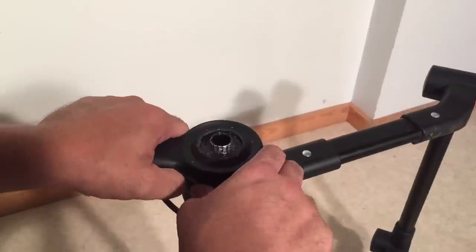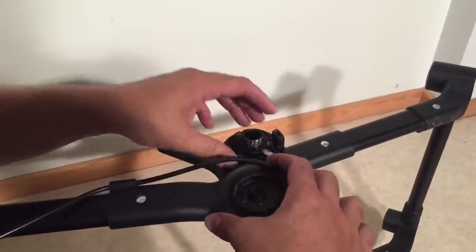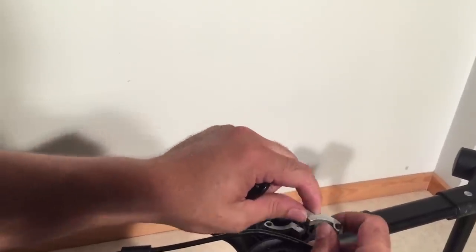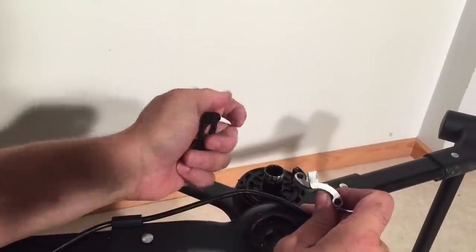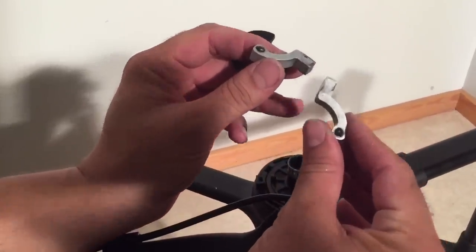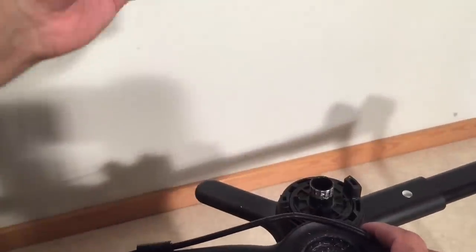Opening this up, you're just going to pop off the first part. What you will inevitably first encounter is the disc — this is the central locking disc. And these are these two — I call them S-hooks, I don't know what they're actually called — these two metal parts. The pegs from the disc have broken off into the hooks. This might have happened with one or two pegs. In any case, it almost inevitably happens with Chameleon 3 that this is one part of the cause.